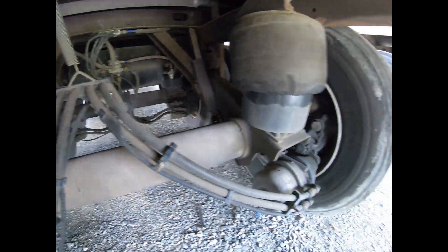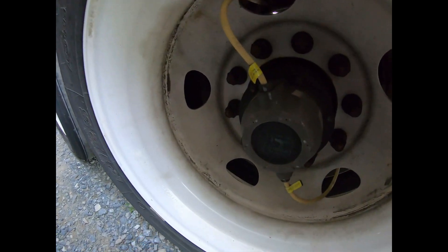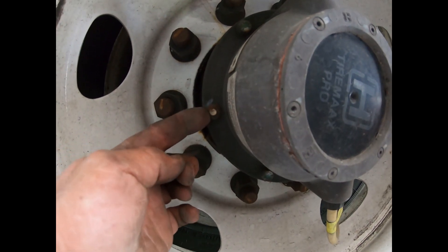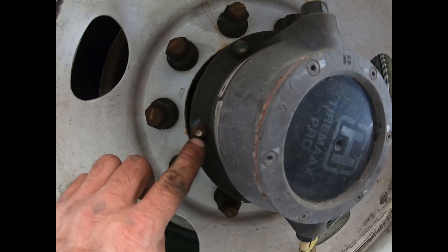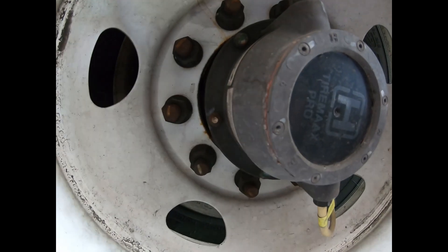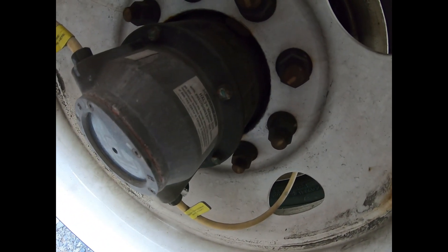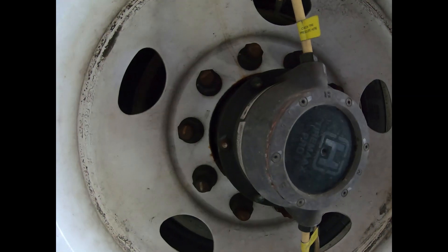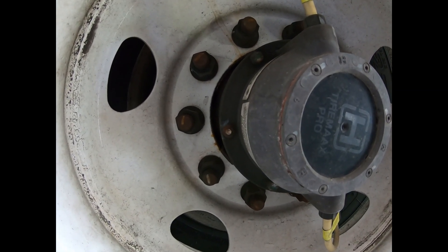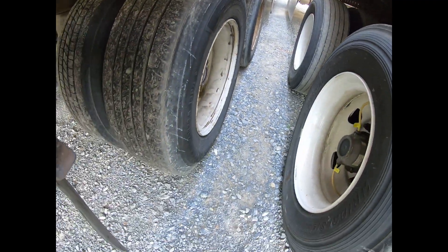Hendrickson recommends in the book that you open up the hubcap and just check. I don't recommend that because if you look at some of these hubcaps — this is another Hendrickson unit on a different trailer — you'll notice one bolt on the hubcap is different from the other. This is a hex head, and this is an Allen head right here, and they have an epoxy packed inside of there. That's their way of checking if the wheel end was opened up. A lot of these wheel ends — this one right here is an HXL7 — has a seven year warranty on it. So if anything goes bad, bearings, wheel seal, that's warrantied. They can tell if someone was in the wheel end if someone picked out that epoxy, and that'll void the warranty. So I suggest checking out the air hoses first and go from there.